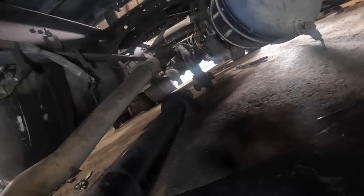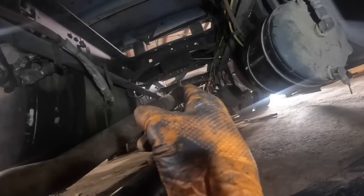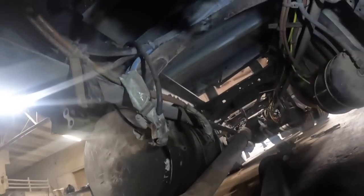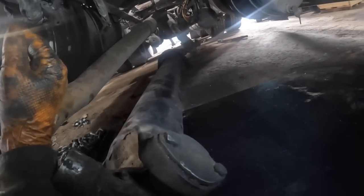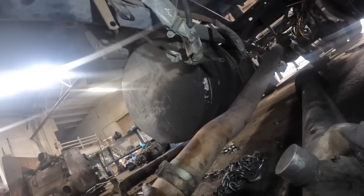So I'm totally screwed up on my driveline deal here, and what I was thinking. When you put this up, then the carrier bearing is way off down there. I did some measuring. The drive line that I pulled out of it would work, but the yokes are different. To make this drive line work, you'd have to lengthen it. That's the only thing you could do. So the simplest thing to me is to use the drive line that came out of it and change the yoke here to match that, and take that yoke back off there, put on that, and then everything, I measured it from here to the carrier and it's dead on. So